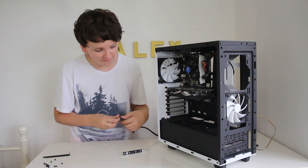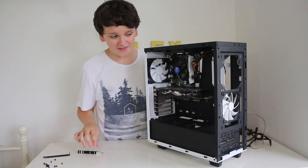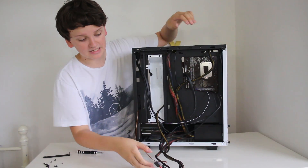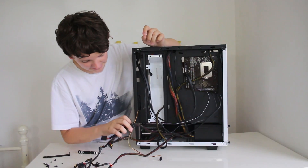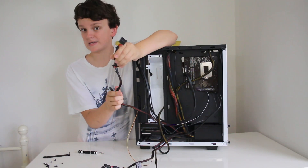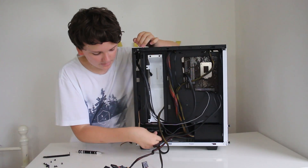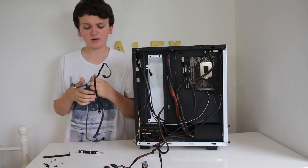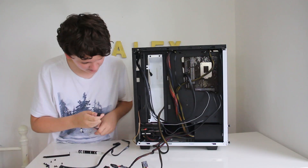All that's left from the power supply is a load of SATA connections and 4-pin Molexes. Remember the 4-pin Molex adapter for the fans — I need to wire that up as well. But first let's wire up the hard drives. Each SATA power cable conveniently has three hard drive or SATA power connections on it. Fold down any excess cable. Then from your motherboard box get those SATA data cables — every motherboard usually comes with two, but since I have three drives I had to get an extra one. Plug these in now — like pretty much every connection inside this computer, SATA connections really can't go in wrong because they all have little notches so they can only go in one way. Route the cables through the back of the motherboard for a tidy result.